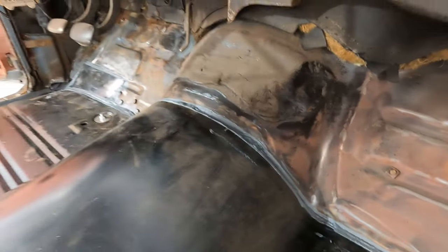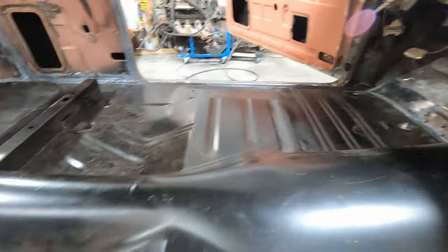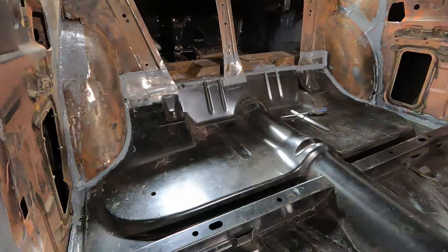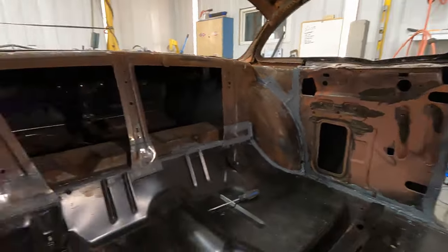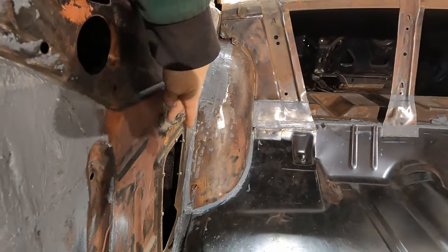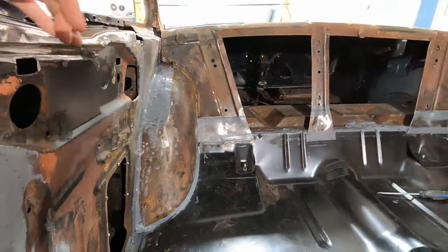Anyways, let me show you what I've got, and then I'm going to start painting. Now, I did take it off a little early, but you can see it did snap a pretty good line. Over here, I didn't really care too much because it's just gooped on. In the corners, I stuffed a lot in because it's a spot where stuff collects. You can see I did the vertical pieces here where the vertical welds are on the panels. This is factory dum-dum, which is a type of seam sealer, I guess, that would have been used. So this is much the same as what I'm doing now.